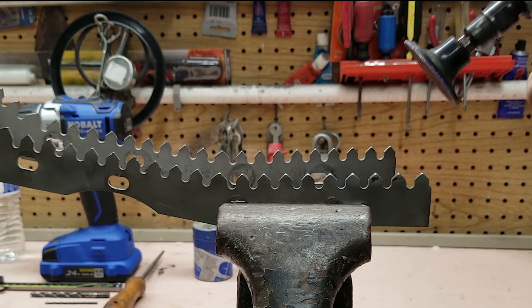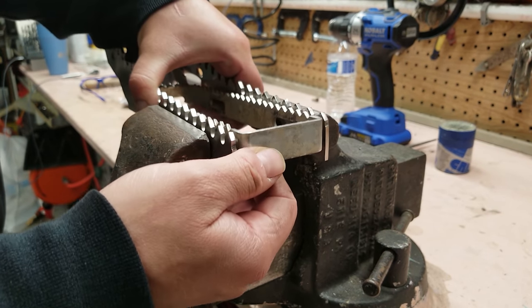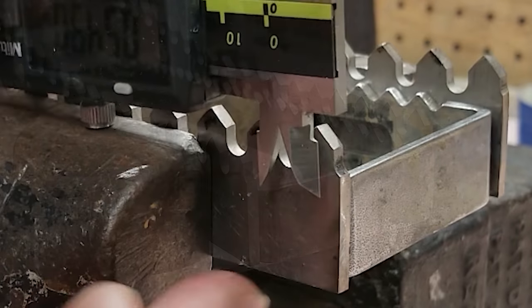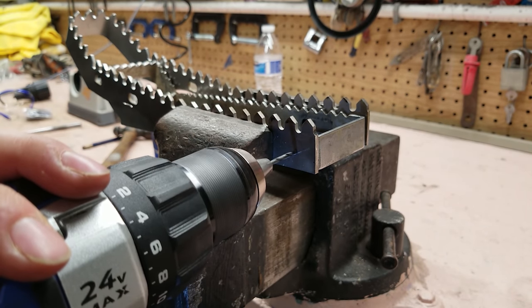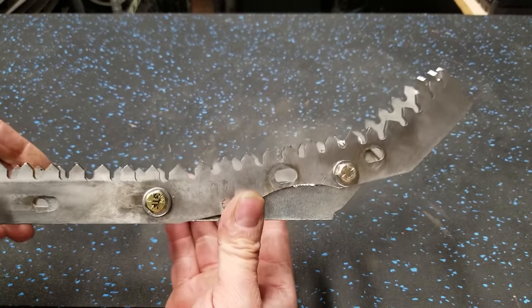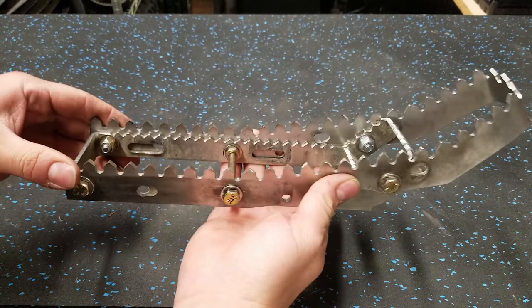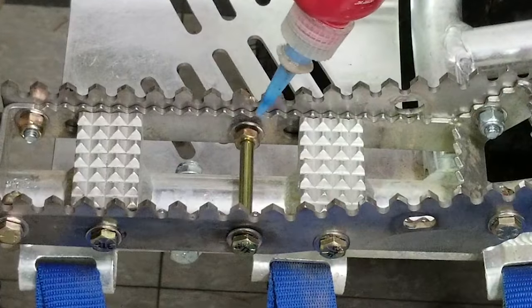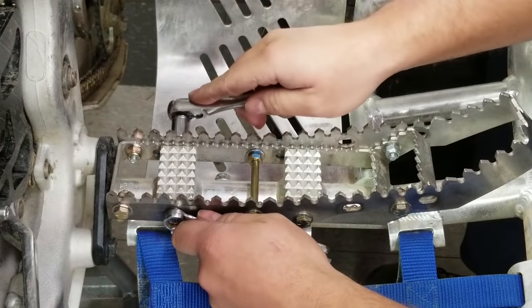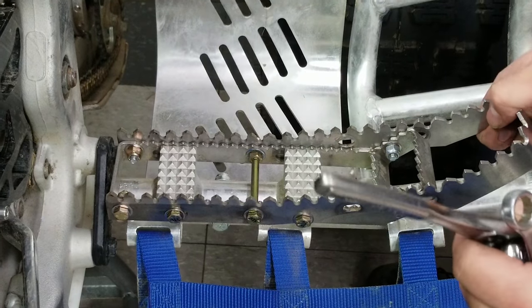Now that we've got them cut down, I'm going to go in and sharpen up these pegs because they're pretty dull. Our pegs are all sharpened up. I'm going to try to get these lined up in here so we can drill our holes - coming in about a half of an inch. Check that out - this is nice and solid. Got all the holes drilled, everything is real sharp. I'll put a little Loctite on the nut on the inside because that is not a nyloc nut. I'll tighten these up from the inside out. That is a solid foot peg.